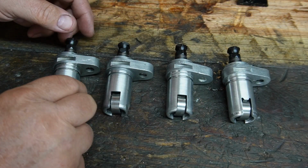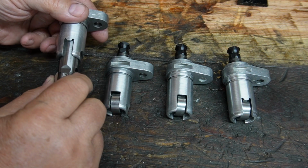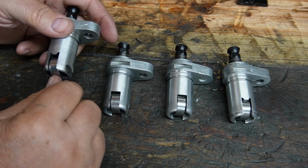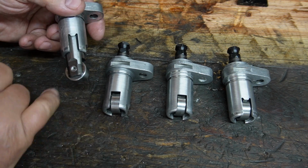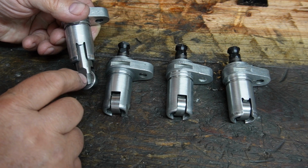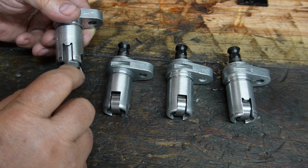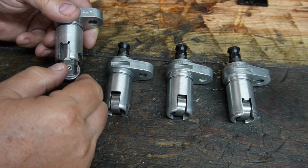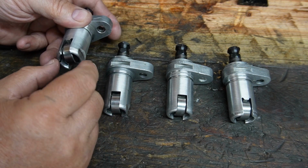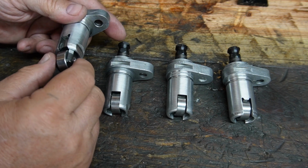And just FYI, these tappets are Eastern. V-Twin sells a branded tappet, and I ordered a set of those once a long time ago. They were junk. One of them was cracked across here, and I suppose it was from the process of crimping this pin in there. On some of the other ones, the crimp on this rivet, or the axle, stuck out far, and the axle was binding on the sides of the lifter body. I sent them back and they gave me my money back, but just another hassle you don't need. These Eastern ones are not bad.